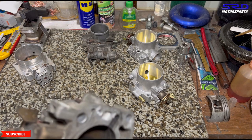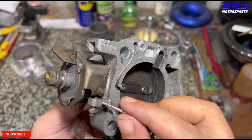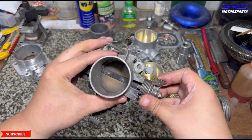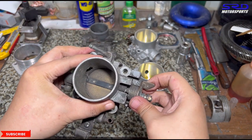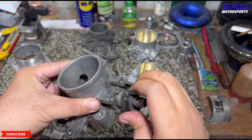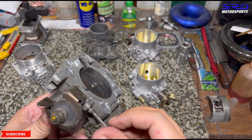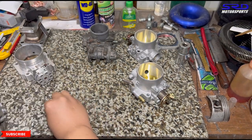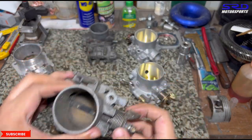Here's the OEM — I backed out the throttle stop to show you that even an OEM throttle will stick if it's not adjusted properly. See — it sticks. But the thing is, the OEM is almost always adjusted well from the factory and the double nut is secured really tight. Once you get the adjustment correct, you tighten it really snug, and there's no more throttle stick.